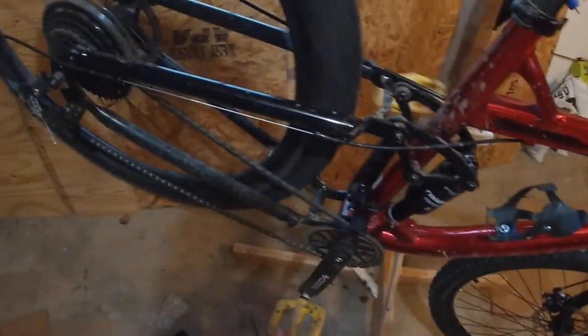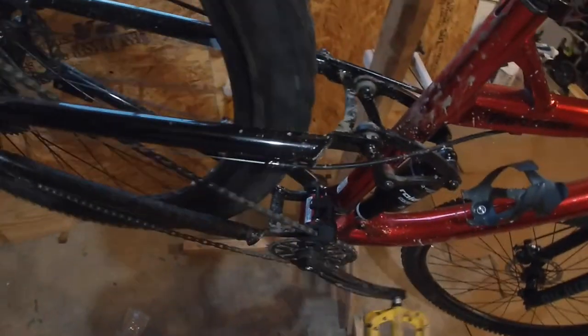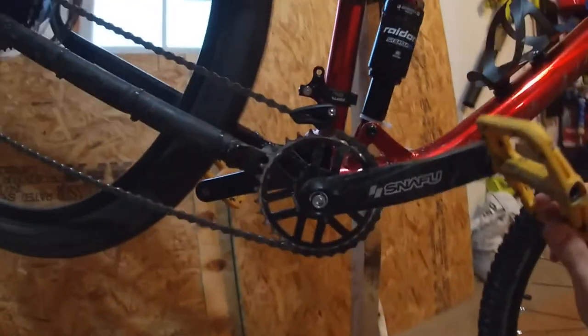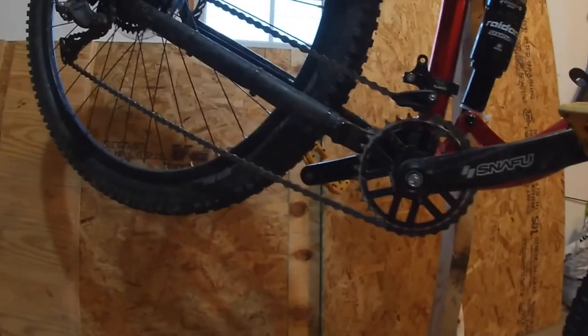I'm going to cycle the gears and pedal. Going all the way to the lowest gear — we've got plenty of space and we're not hitting the guide. Looking down, it's pretty close on the inside but it's not touching, so we're good there. Going to the highest gear — looking straight down, it's kind of close but it doesn't hit, and we still have plenty of guide beside the chain so it's not going to come out that way. As it is right now, we shouldn't drop any chains from going over some gnarly stuff.